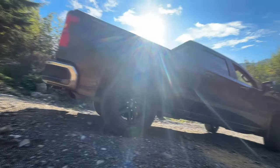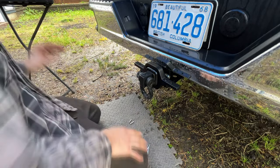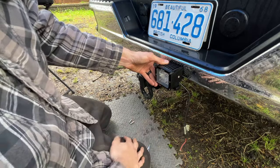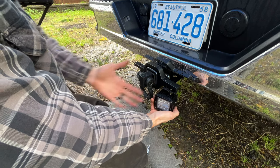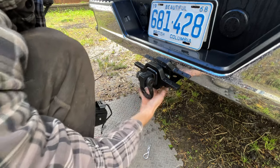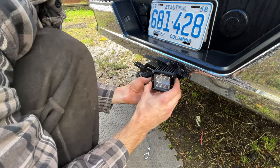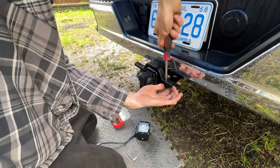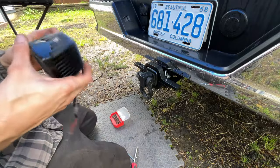What I'm getting at is if I put my thing like this right up there — fits well, nice fit — but they will fit so tight that this vibration would scratch it, and I can't aim them. So what I'm going to do is put a little plate. You can flip this thing around and mount them this way, but now this is the lowest point of my vehicle and this is going to be the first thing to hit the ground. I would rather it be this strong metal here. So I want to keep these lights safe — we're going to end up mounting them up top. A little extension is all that's needed to be able to point them out. Chevy's got a super tight back here, so you just got to slide your guy like that. It's nice and strong, tightened up.